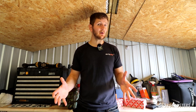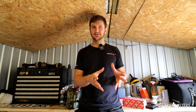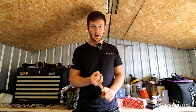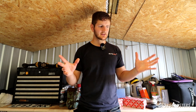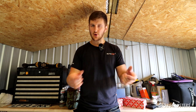The engine actually sounds better now, I think — I don't know how that's possible. I also took it for a test drive and it seems a lot more responsive. Obviously we've swapped out the spark plugs, ignition coils — which are a few years old, last swapped out about five years ago or so — and then the intake gaskets and then the breather valves, which we've put the old ones in for the time being. We've swapped out the breather hoses as well, so we've done a lot to this engine.